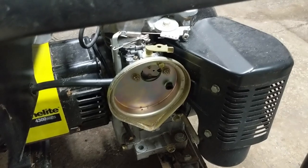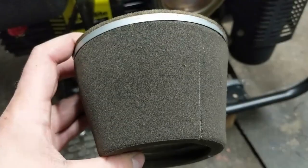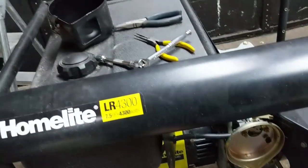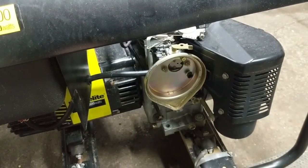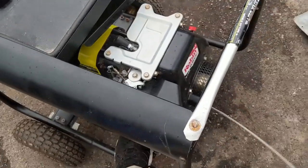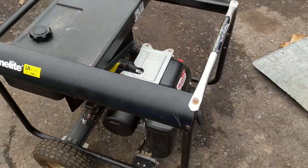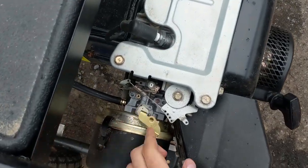I reinstalled the air filter — it's in excellent condition and the pre-filter still looked good enough. I got some fresh 91 octane into the fuel tank, double-checked the oil — level is satisfactory. I got the fuel in the on position, choke is on.